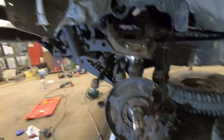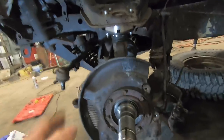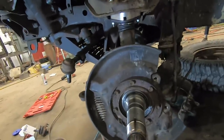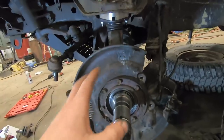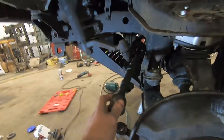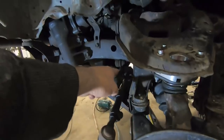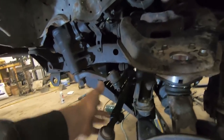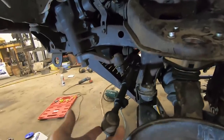It's the next day now. It looks like I've got the ball joints fully installed, the spindle is back on, I've got the CV axle in with the washer and C-clip. I'm pretty much ready to start putting the hub back on and the brakes back on. Still need to take the tie rod off — I need to make sure all this is loose before I disconnect it, and we'll measure the length so we can set the new one pretty close.